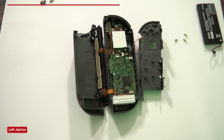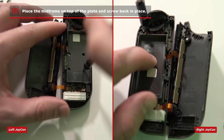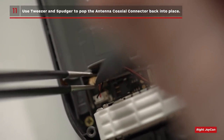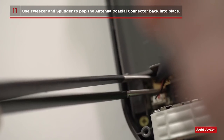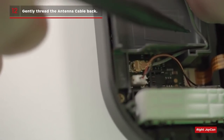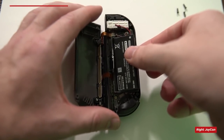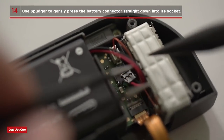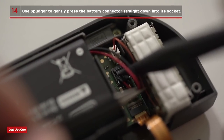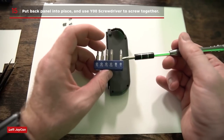Now, I don't know if this is temporary, because it's possible that if the issue is the contact with the metal inside and this pressure just pops the metal out, the metal could still wear down at some point. But it appears this solution works even on Joy-Cons where electrical contact cleaner and other things don't work anymore — people who were doing the contact cleaner every day and getting maybe an hour before drift returns. They went to this method and it just worked.